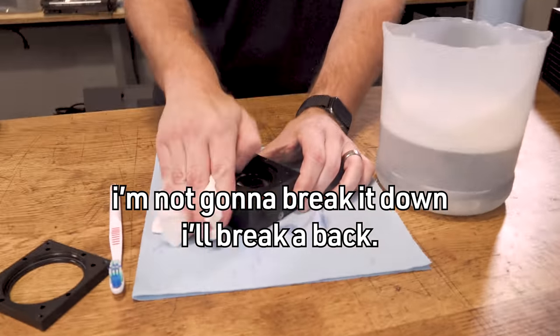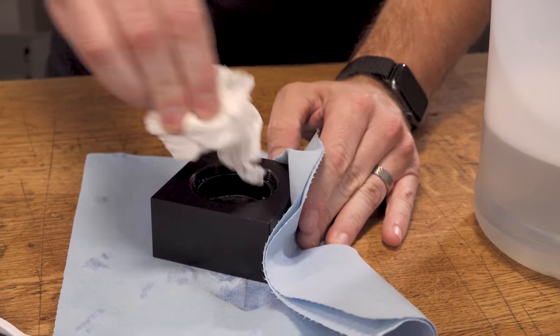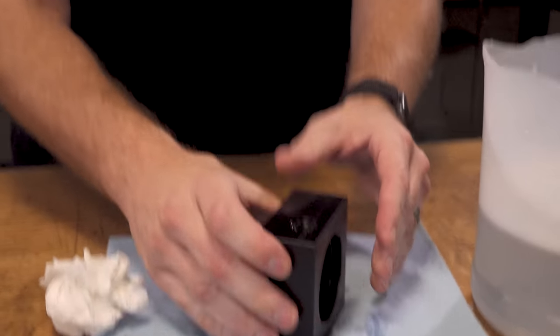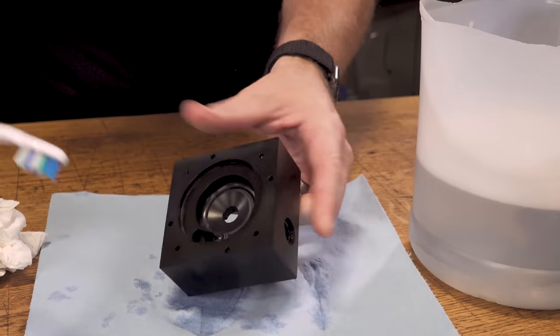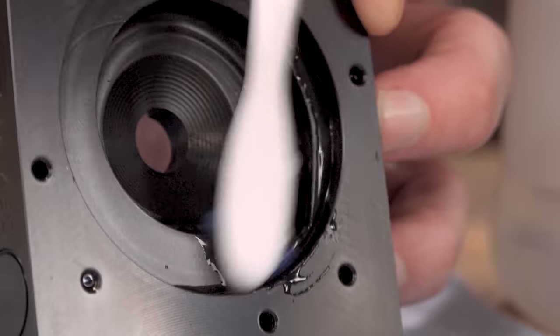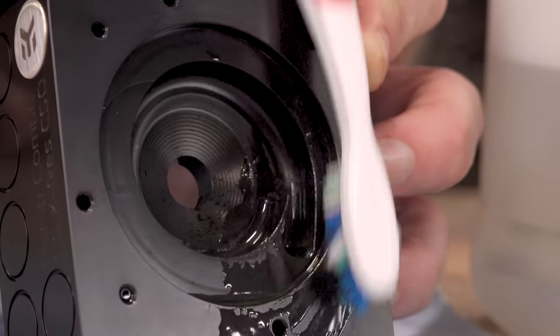That's one of the reasons why we think the yellow fluid kept failing in the past — I had three graphics cards on there, and even though I had a 560, the coolant temp would still get really hot. A lot of findings showed that high heat breaks it down. So now I'm going to let this continue to soak. The one key ingredient people leave out when doing their cleanings? Heat — it'll break it down. There's one other ingredient I'm going to use: compressed air to blow out as much as possible.